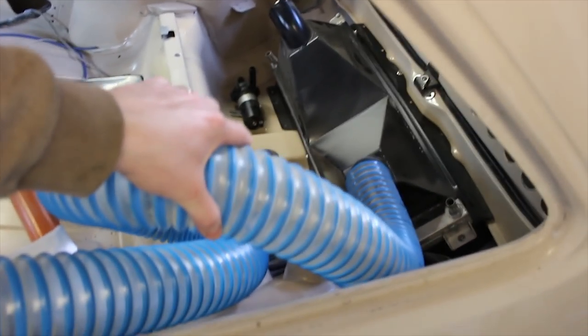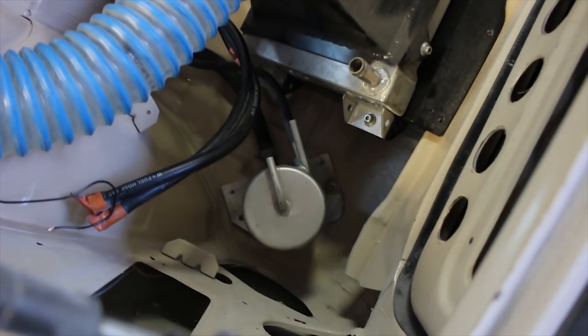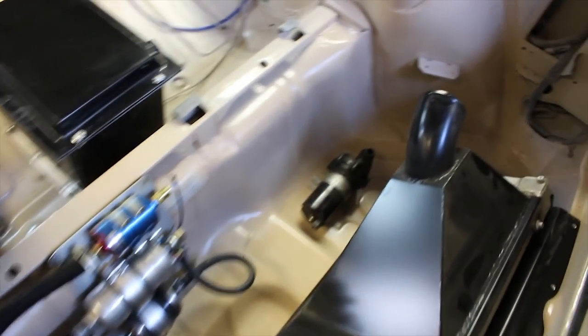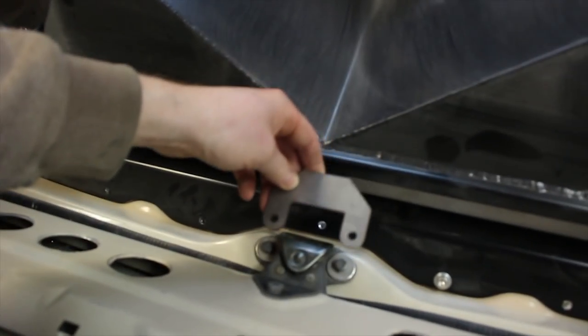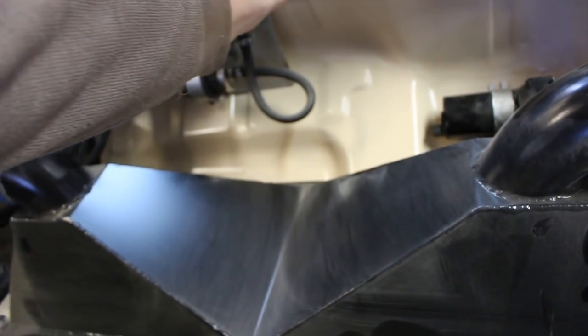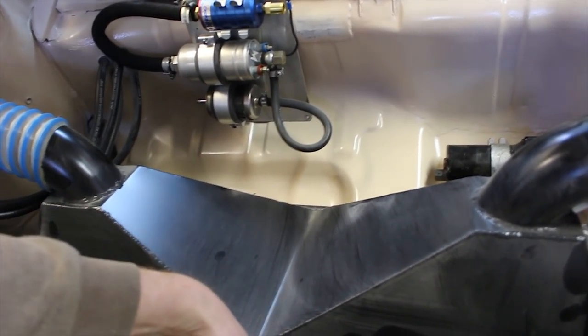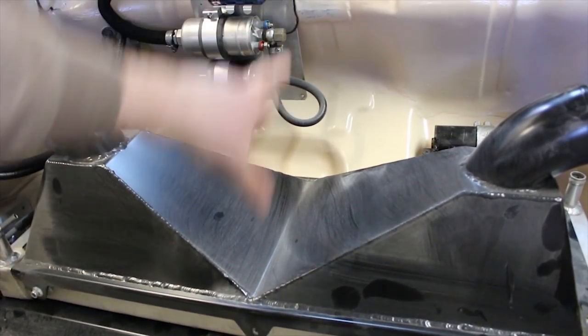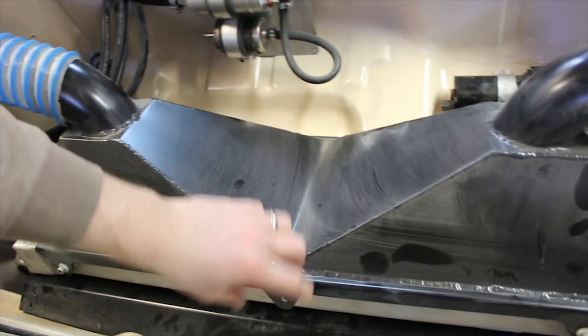Just mocking up the swirl pot — I don't know if I like it in blue, I think I'll try and get some of the old fashioned solid orange stuff. Also laying out where the swirl pot's going to go and working out where to mount all the pumps and filters. I've still got to do the charge cooler system — that's the charge cooler pump. Zach's got to weld up the tank for that corner, and that's all of the rear boot radiator semi bolted in. I've also got these plates: the plan is to weld a couple of D-tab things up here where I've put that little reinforcement plate in, then do a rectangle box section that kinks up, comes across and bolts onto that and into the eyelets, to give a little bit of bracing between the back skin — because I cut the original one out — just putting a little bit more strength back in there.